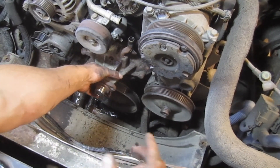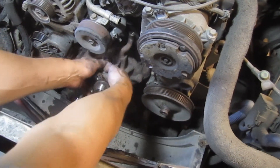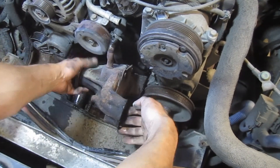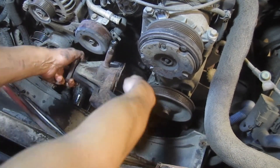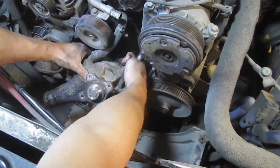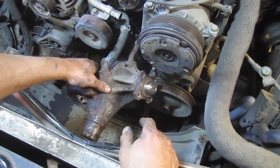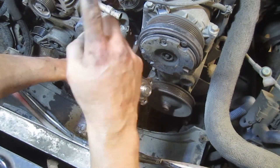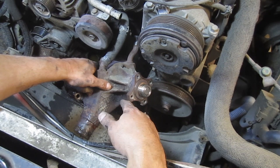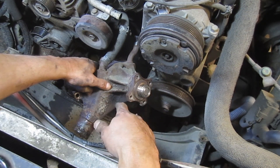The water pump is out. When the new one comes in I'll do part two — the water pump installation video — and we'll put it back together. I'm going to clean up the gasket surfaces on the engine so they have a nice seal, get all the grease and debris out of it, and we'll be ready to reinstall. I need to get this last hose off too but my battery's dying. Thanks for watching — click here for part two. Leave questions and comments below. Take your time, you can do it.